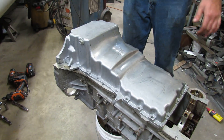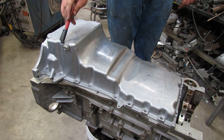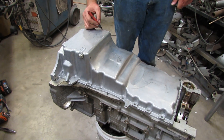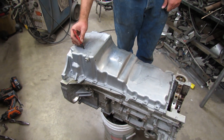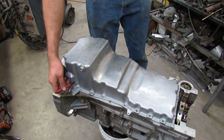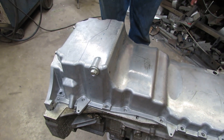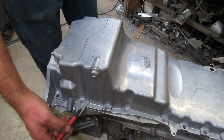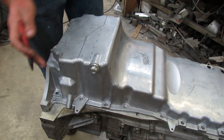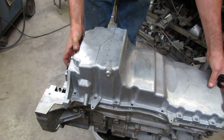There are a couple of ways you can do this. What I did on my Studebaker is I extended the sump. I had a cut that looked something like this — I basically cut the oil pan along that line, expanded it, and then took segments out of the six cylinder oil pan rail and added them in to fill the gap.